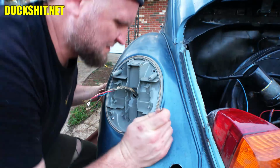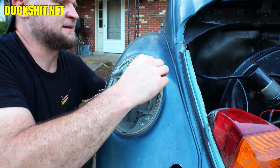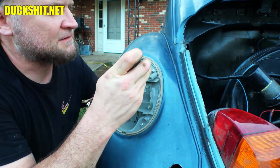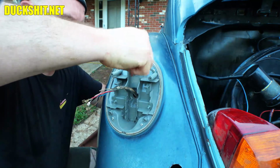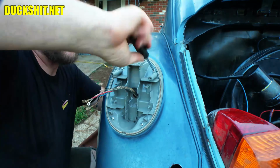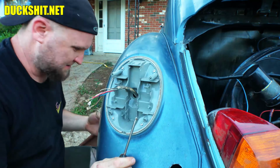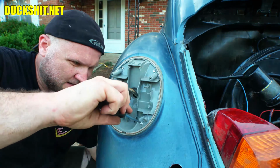Alright, there were no rubber grommets to go underneath these things. So, like I said, you don't have the rubber grommets, and you don't get one. They're real easy to go in later, though. It's four screws: just loosen the screws, slip the grommet under it, and tighten them back down. What I've been contracted to do was make these things work, not mess around with a bunch of missing parts. Nope. No, sir.